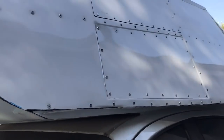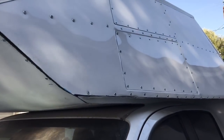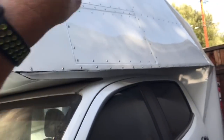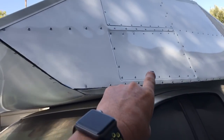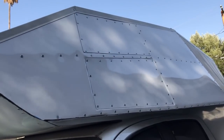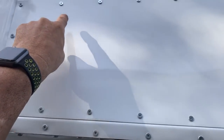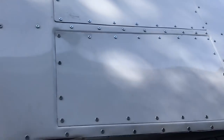You can see this front section that had the bow in it. What I did is I pulled everything apart and put some straight tubing that goes this way, this way, and then you can see where the screws are. That still really wasn't good enough — I had some spots in the center that needed to be shrunk. No way to really do that with a painted panel, so I was stretching all of this in to make kind of a recess, and I just took a panel and put those on both sides. Seemed to work out pretty good.